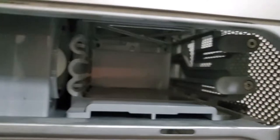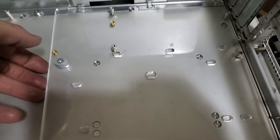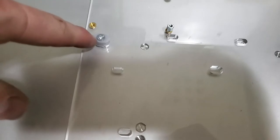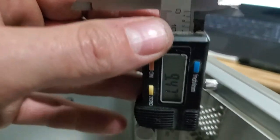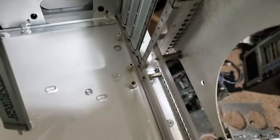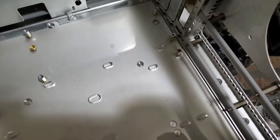Fiddling around with this thing, trying to put the motherboard in, messing with stuff securing the backplane down — I did what they said: three of those nylon washers plus the countersunk screw. But this one turns out to be much taller — 9.48mm taller than the motherboard screw-downs at 8.7mm, so that's no good. I'm just gonna break that one off. I'll grab the pliers and break it off.